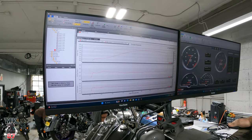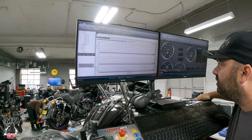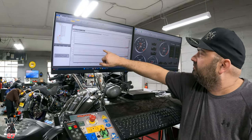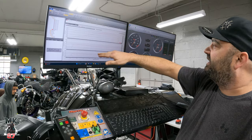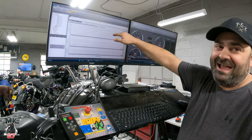Were these the bad numbers? These are the bad numbers, because this bike did start. You got some erratic lines here and here. The clutch is slipping. The bike was starting to slip on me somewhere around 4 to 4,500 RPM. Oh, wow. So that's where you see that black. Right? What does it do? It goes black.